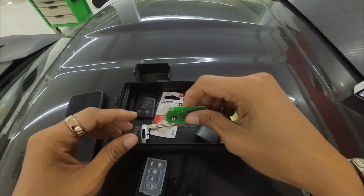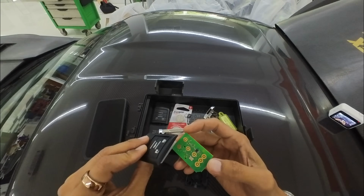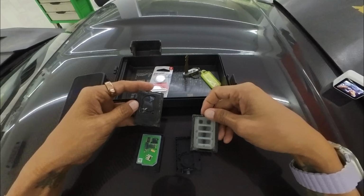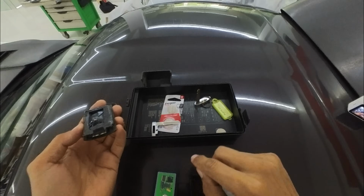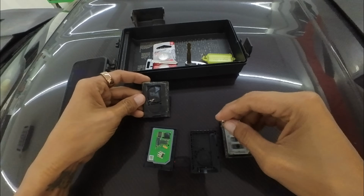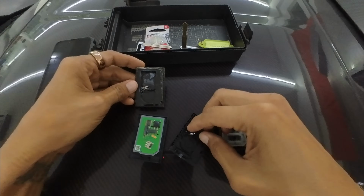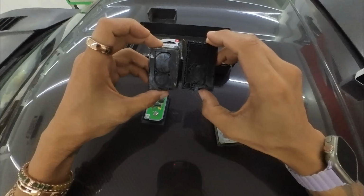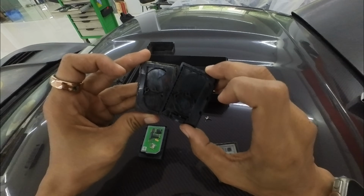Basically, the new key fob has to sit inside. You see the 3 buttons on top, which would mean that it will be like this. The previous key fob detached and it was glued already, so we need that ring. So I need this, which is the grounding clip. Okay, so that goes in there. I don't know if that's the correct position. Let's compare. So this one has a post in the middle, this one does not have a post in the middle.